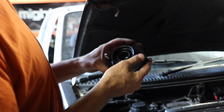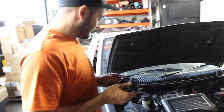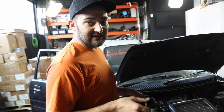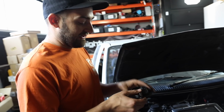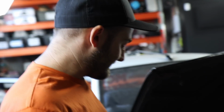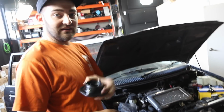It's just newer and it's a bit madder, and because this car is mad, then I feel like it needs these bits. I am going to put the new springs in the front as well, just so it's a matching set. They'll probably be alright as they are, but I'd rather use the four of them. So I have to take these off anyway, which is a perfect time to put the new springs in. So shock out, spring on, new strut top in, back in, wheel alignment.